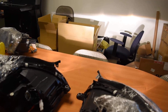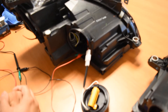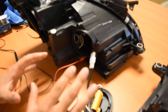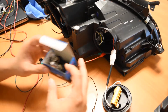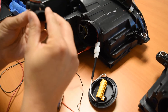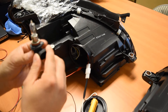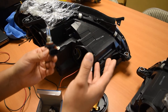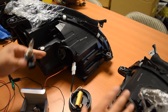So what we're going to have you do is actually twofold. I'm going to shut this off real quick just to show you the test moving forward. For the sake of simplicity, this would help greatly to speed along the process and isolate components down to one final component. What we kindly ask you to do would be to source just two halogen 9005 bulbs — just something like this. You can get them at a local auto parts store; they're usually not that expensive. These are not polarity sensitive and don't require any canbus modules. Basically, this is going to help us limit the test and the documentation to just the headlight itself.